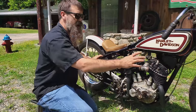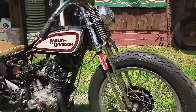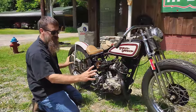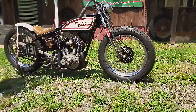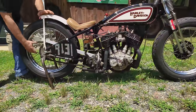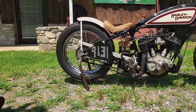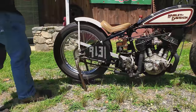A light little single-cylinder D model fork — common among racers — probably five to eight pounds lighter than just about any Harley-Davidson fork of the same era. 18-inch wheels. We run Avon Road Runner tires — nice and smooth ride. This machine is absolutely made to go fast and the less drag the better. When you've got a machine like this with limited horsepower, the better things spin and the freer things are, the faster you're going to go.